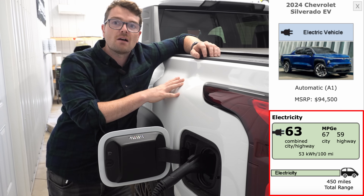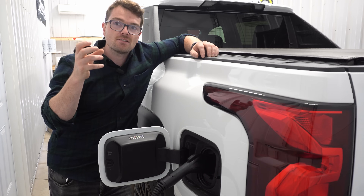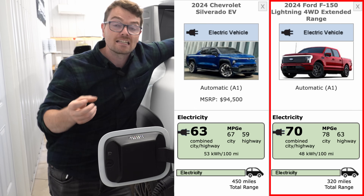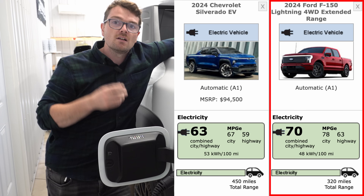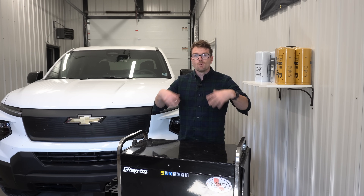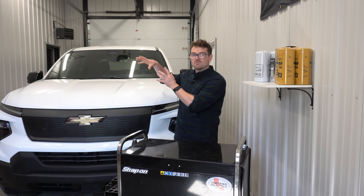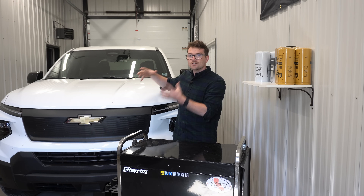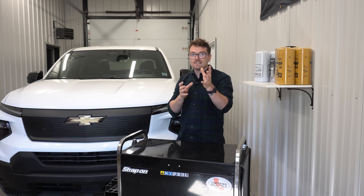Essentially, this truck over 100 miles will consume 53 kilowatt hours. In comparison, the Ford Lightning is actually a little bit more efficient — officially rated at 70 MPGe by the EPA — meaning over that same 100-mile stretch, the Ford Lightning would only consume 48 kilowatt hours of energy. So it seems like with current EV technology, you can be more efficient with a smaller battery pack, being lighter, yet have less range. What GM has done with this truck is technically less efficient and heavier, but with a larger battery pack the end result is a much longer range. It seems like a bit of a give and take.